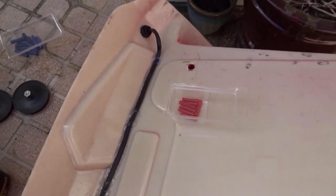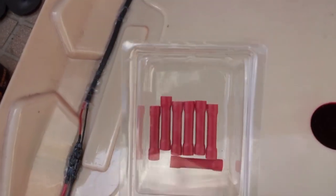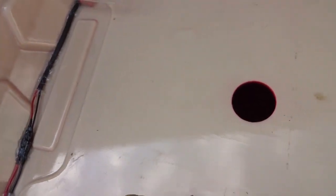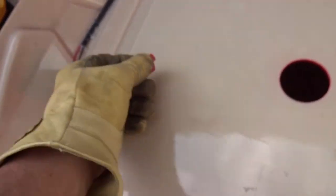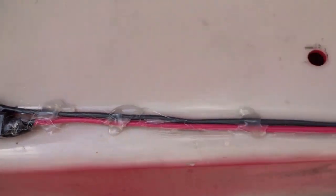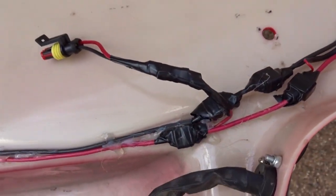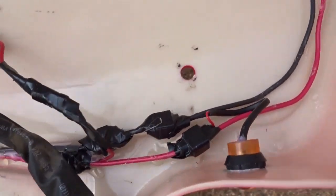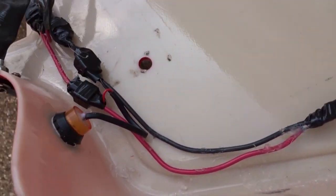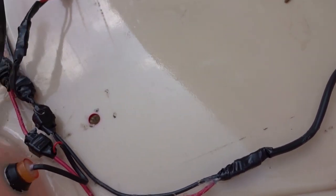The wiring harness is held in place with hot glue — I want to make sure I don't have wires hanging down and flopping around. All my connections are basic: butt splice connections and tap connections. Where I have two wires meeting at the end I did a butt splice, and where I was tying into a straight run I used a splice connector. You can see I have a waterproof plug so I can take the whole deck off — it connects to the charging port.